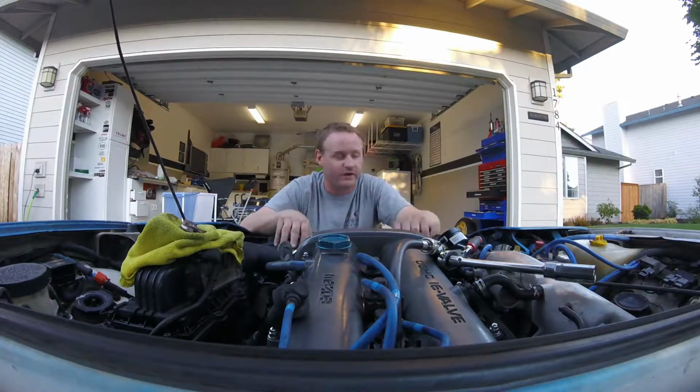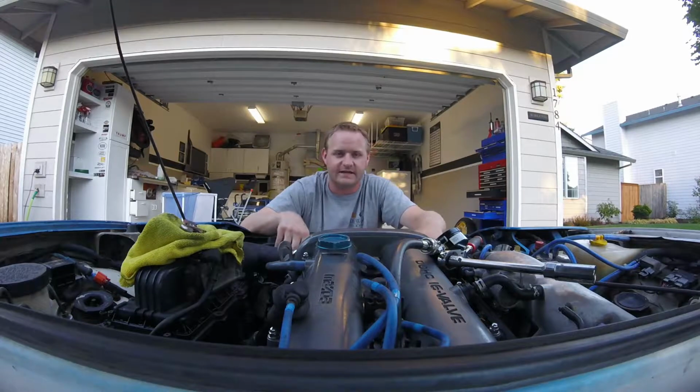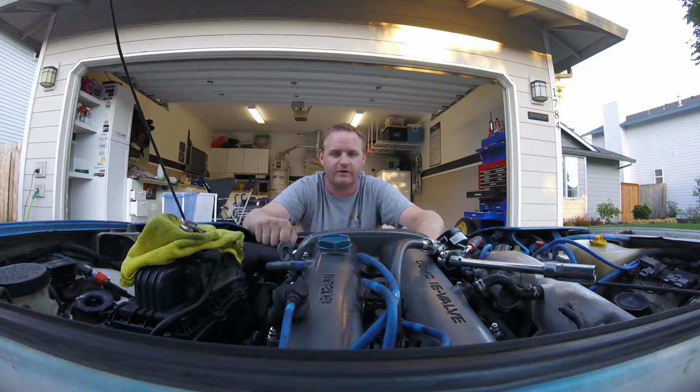The lights all went out in the car, wouldn't work. Tried another battery, wouldn't work. Took the first battery in, so got it tested, 100% good. Then to find out, tug on the battery cable, the positive side a little bit in the trunk, pull it toward the rear of the car, lights come on in the car.